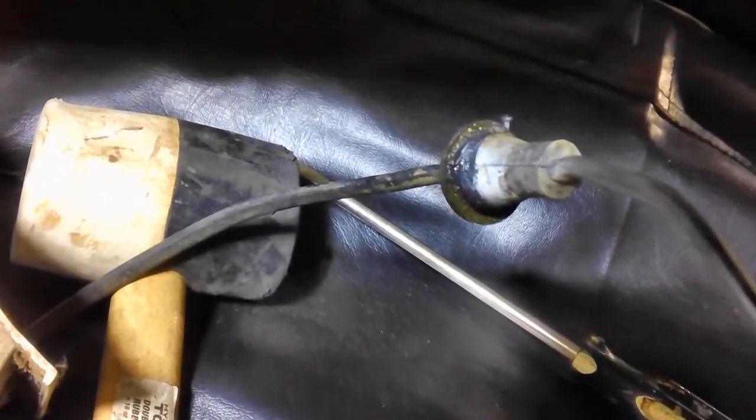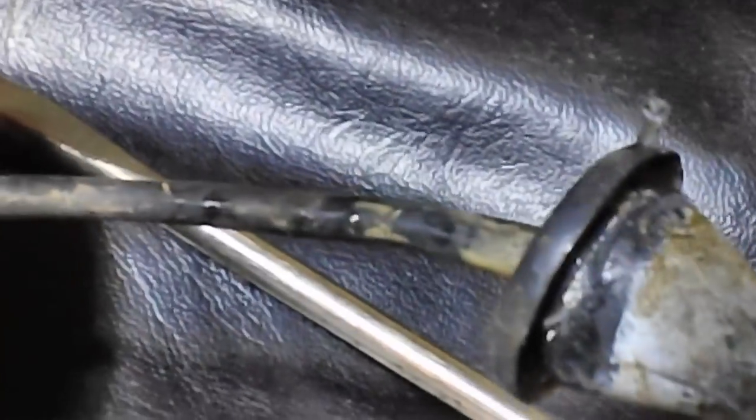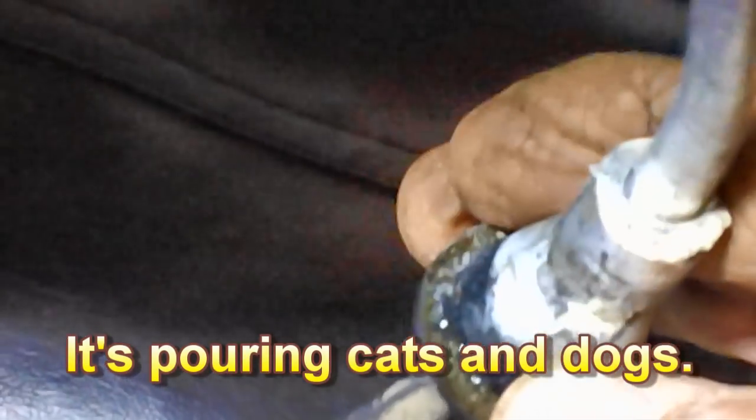Anyway, these things, they push them up through a hole in the fender, and there's a little ridge around the bottom there that you can see where the sheet metal on the fender will snap into that slot at the bottom. And all you'll see when you look down in there, when you're getting ready to remove the wire, is the part here that's painted white on this car. And it's wedged through the fender, and the fender's down in that slot, and you're thinking, how on earth am I going to get that thing out of there? It's really not that difficult.